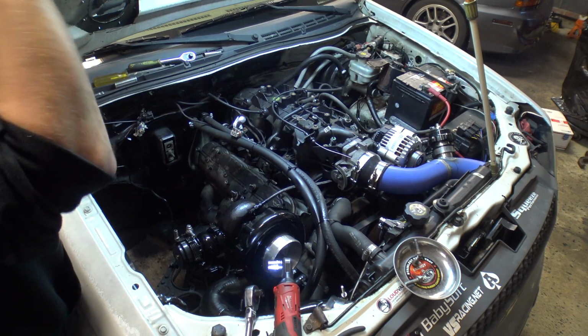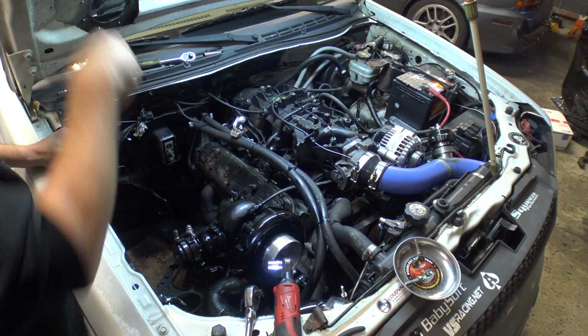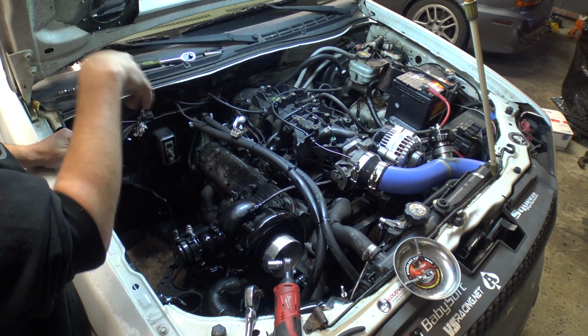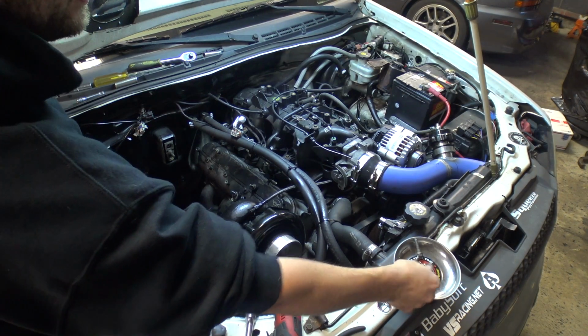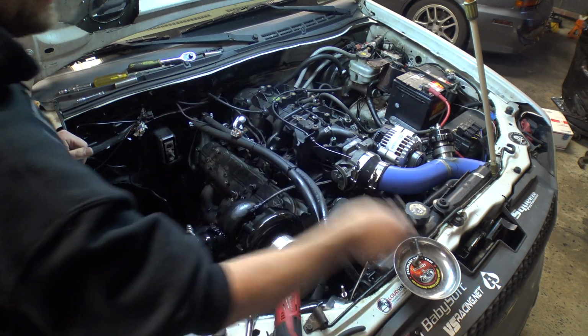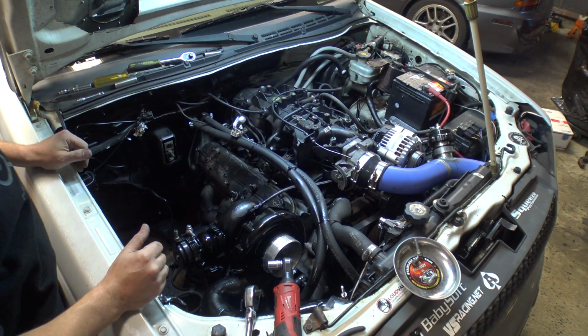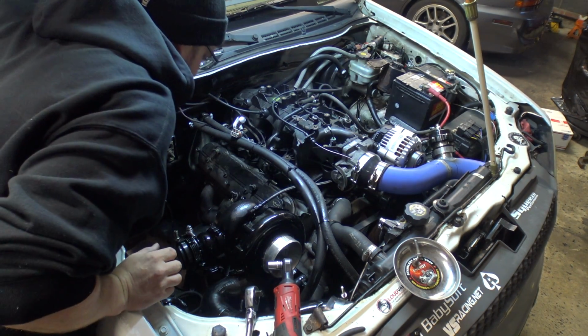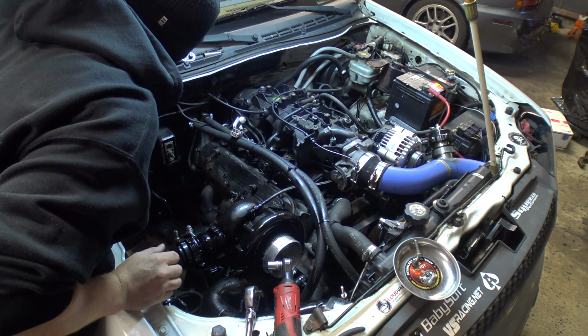Anyway, I think when I go back inside, I will order bolts just to have them, because there's 10s on that side, even though there's no weight over there. I like to put the 13mm heads on the side that supports the entire log and turbo, even though I haven't really had a problem with the 10mm. It's just less stress on the bolt head, I think, anyway.